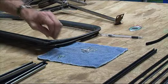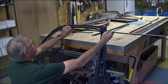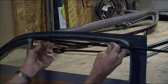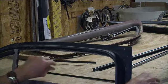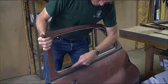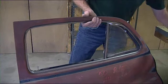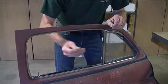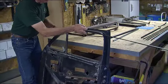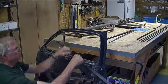Here are the little screws that come in the kit. Use the screws on the door side and tell customers to start attaching as you go — in other words, take the little screw and attach it now. The reason I suggest using our little screws: if you try to pop rivet that, more than likely you will put a dimple in your chrome trim. You're apt to dimple from the back side and dimple the stainless, and you don't want that. The screw is more controllable. Bend this strip as you go — don't try to bend it outside the door.